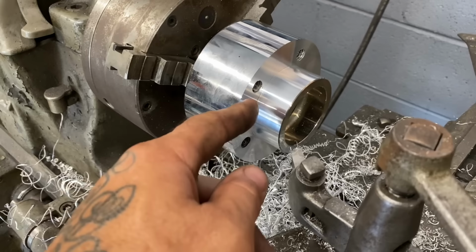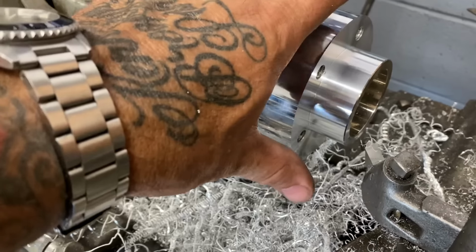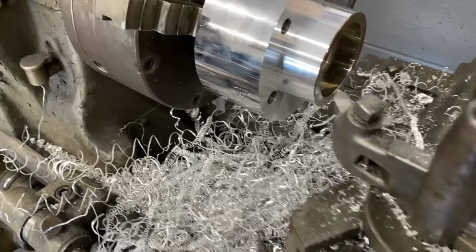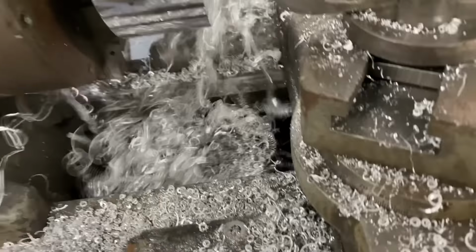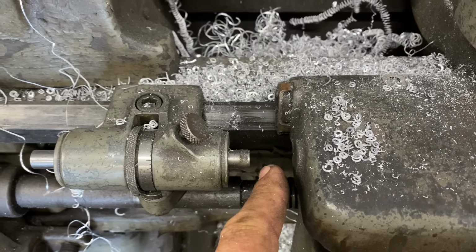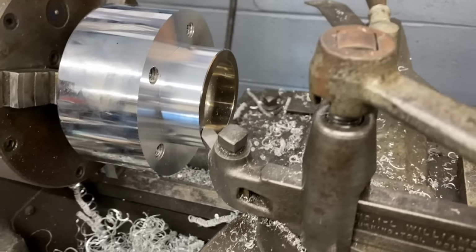Here's my wheel hub with the 0.08 I cut off of it. There's a little centering locator that's going to be raised up here that will center the hub in the wheel itself. So I'm going to do the same thing I did when I was surfacing the hub. I'm going to go to the end of the locator and set 0.08 up here, cut back again, and then I'll have my indicator done, and I'm ready to cut the bearing spacer and put this back together. Let me move some of these chips back. These chips are all what that hub used to be.